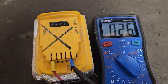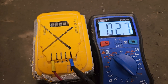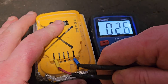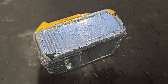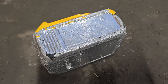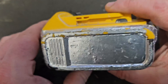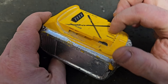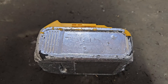The first test, as always, is a voltage check. As you can see, this is throwing out 2.6 volts, which for an 18-volt battery is not that much — or 20-volt max. When that battery is fully charged it should be throwing out about 20 volts; when in use it's probably 18 volts, that's a nominal thing. Really the range you should be getting to have a chargeable battery is between 17 and 20.